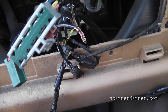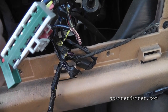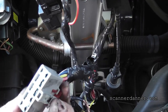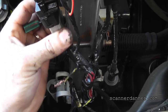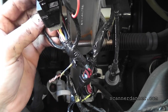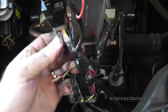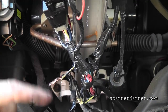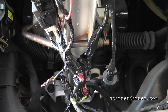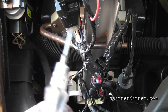We fixed the open, didn't we? However, we did not take care of the no power coming out of this ignition switch. We didn't plug this back into the switch. Plug this back in. I should have power here — let me put the key in. Yeah, see — cranking it, but I still have no power.